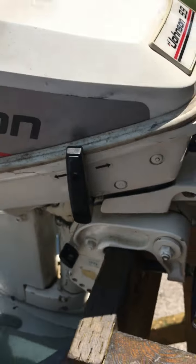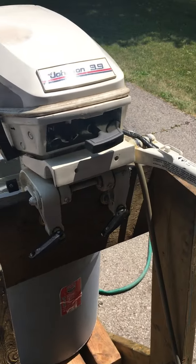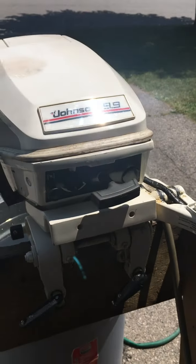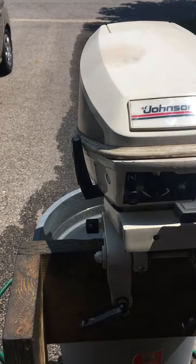I really enjoyed it for years and years, but lately it hasn't been idling that well. So I replaced the crank seals — top and bottom — and it seems to be running a little bit better now.